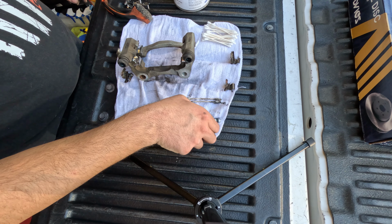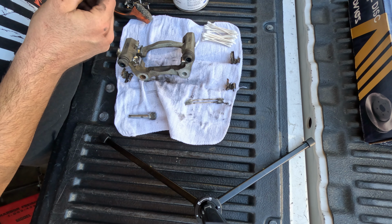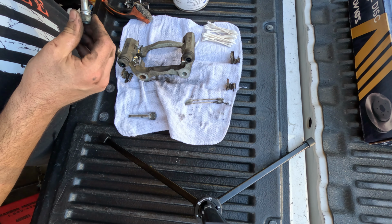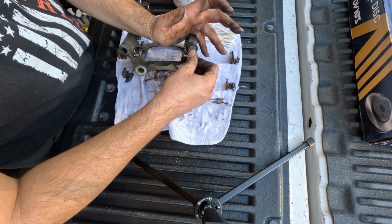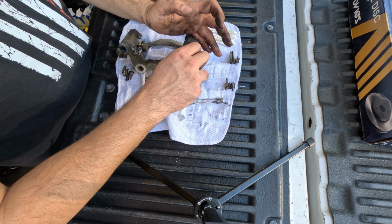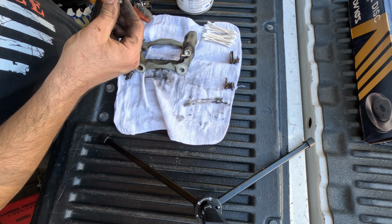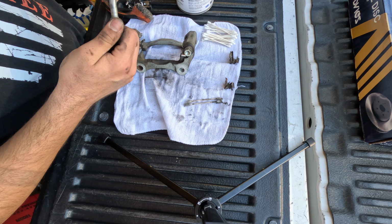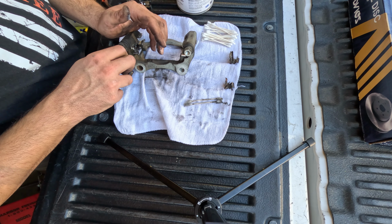Get you some brake parts grease. I'll put it in the description which one I'm using. I've been using this one for years. Never had a problem with it. Never had swollen gaskets. So I keep using this one. I keep buying this one. You don't want it to go too crazy. Just a nice film of it, and it'll be good to go.